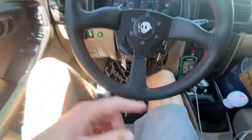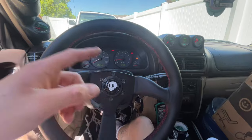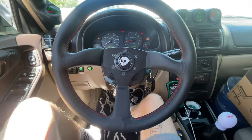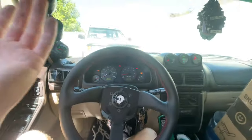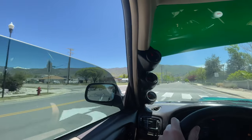I still need the new AC condenser. I have the AC hoses underneath my seat — all the AC hoses for the AC. But the condenser on the STI engine is different; it has different plugs than the Forester. But luckily, if I buy a Forester AC condenser, it actually bolts onto the placements on the STI and locks still like normal, and it just has the right side plugs that fit the stock Forester AC lines. Then we'll just have to get it charged, but that'll be another video when I find the money to do that.